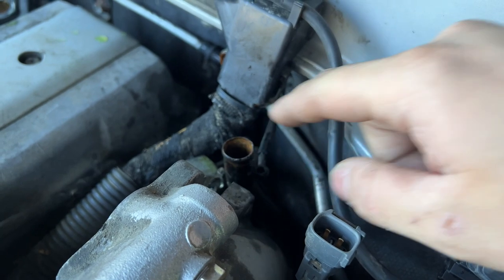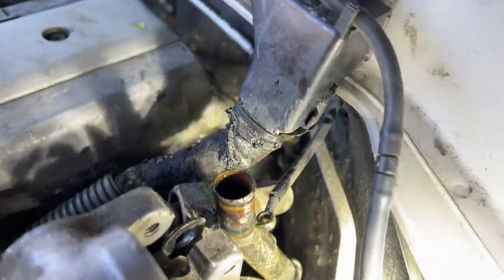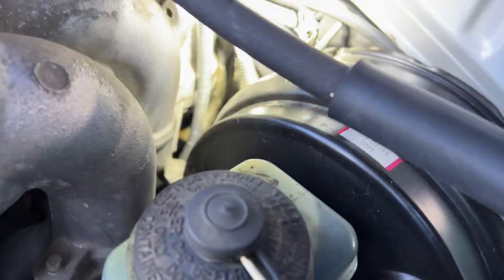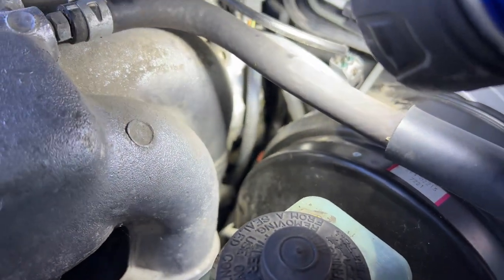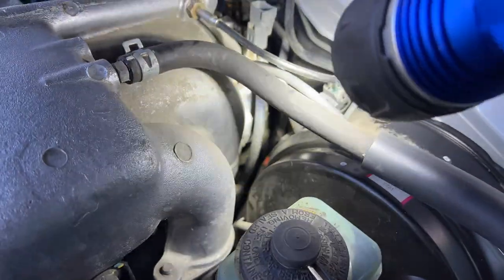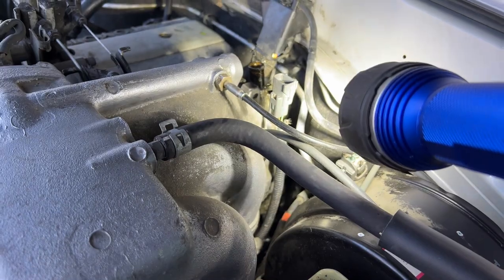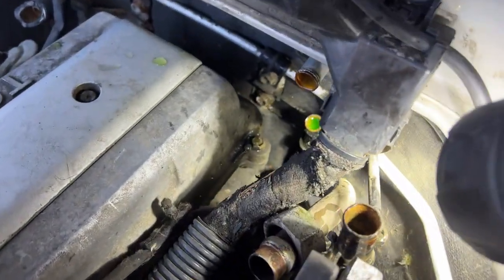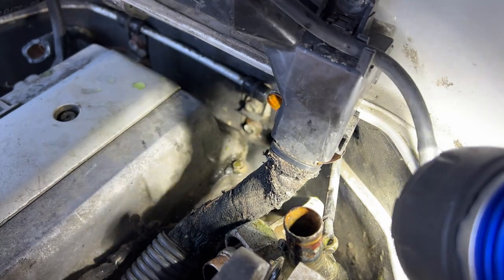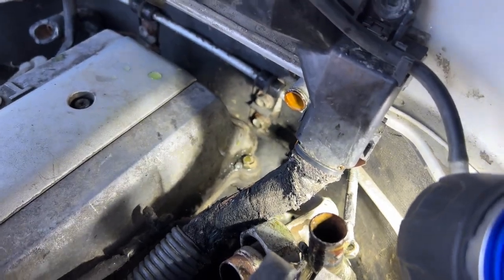What I'm looking at is that pesky heater hose — this hard line here — that goes down. If I look down, I can see the bolts for the EGR exhaust pipe. I'm thinking that if I go down here, remove the driver's wheel, and remove the pesky heater hose, I should have access to get to the two bolts using some long extensions and swivels. Getting it from the top is not going to be an option — it's way too tight against the firewall. We're going to have to remove the front tire and attack it from the bottom up.